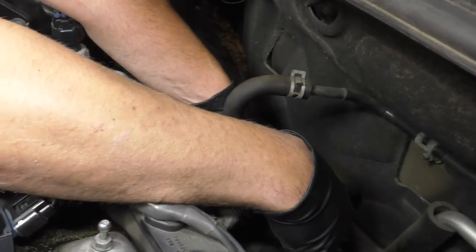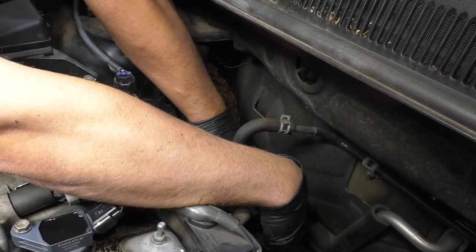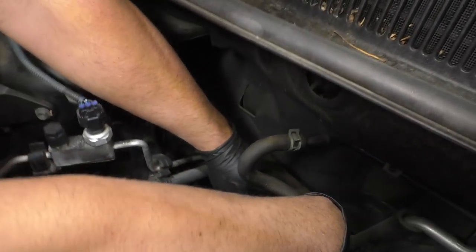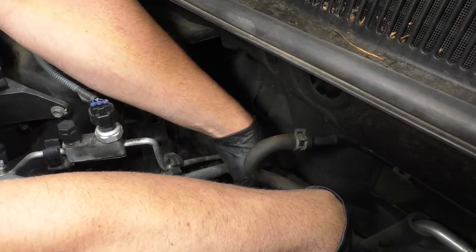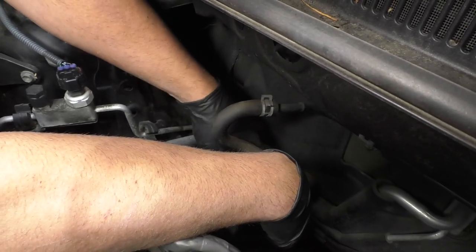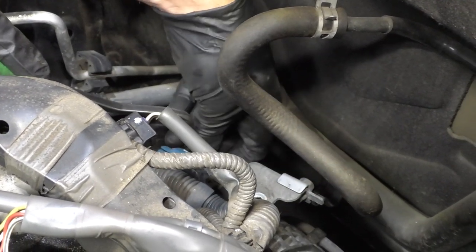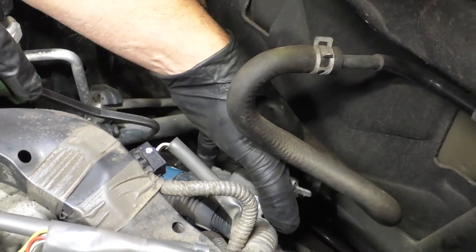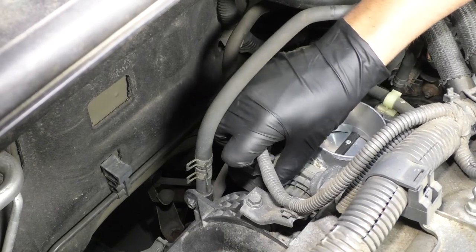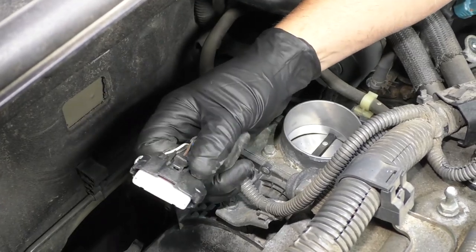There's one of these hoses still attached to the intake that goes to the solenoid right here — the bottom hose — so you're going to have to try to get that one off. You can either disconnect it on the intake or disconnect it on this side. It's just a vacuum hose. If it's pretty brittle, you could just cut it and replace it. I'm going to use the pick — there we go, a little bit of vacuum there. Slide that off. Disconnect the connector right here, push down on the button, and slide that off.